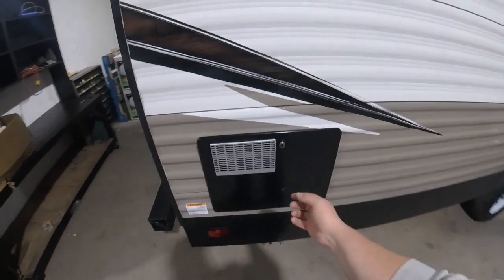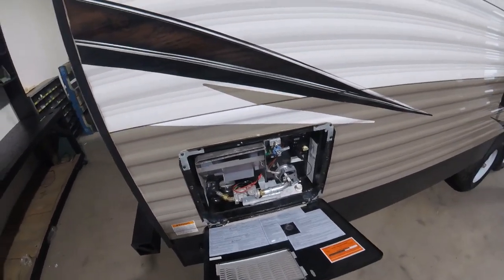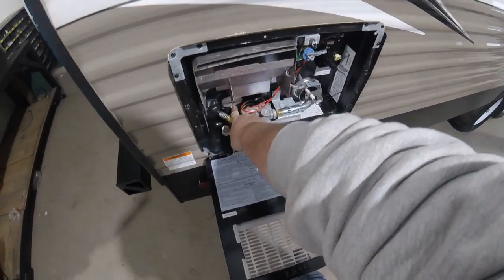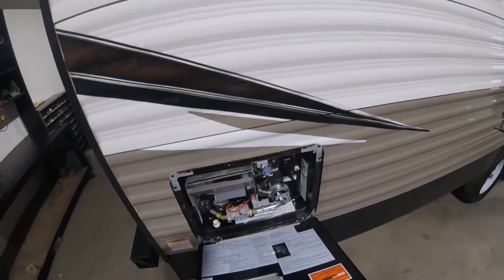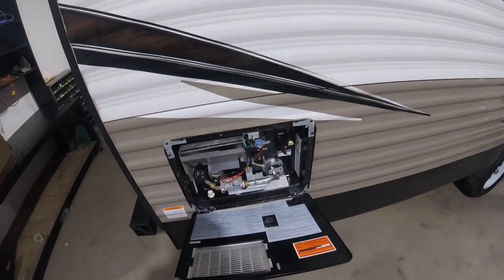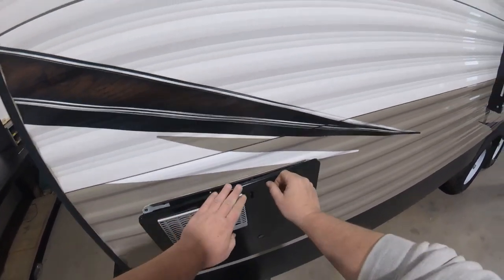On the door side you have your hot water heater. Turn the tab and it comes open — everything is controlled from inside the trailer. The only thing you may have to do is remove the drain plug, which is in the bottom corner. When you want to drain the hot water heater, you need to take the pressure off the system first by opening a set of taps inside before pulling that plug. Also note that the pressure relief valve here is common to drip — if you notice a little dripping there, it is normal.